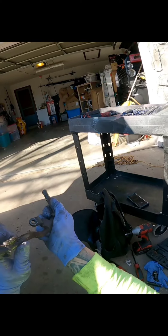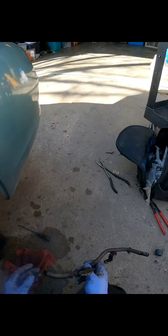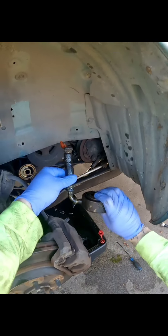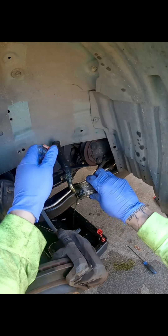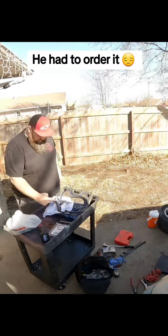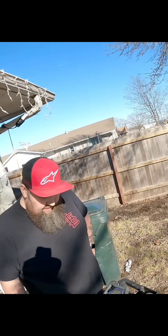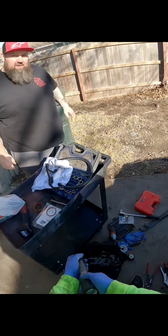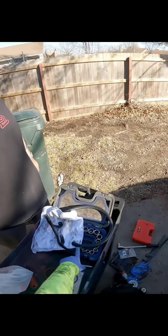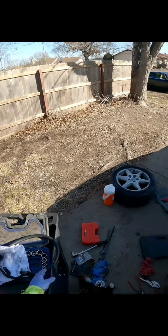I would for sure replace them. So yeah, look — oh boy, I don't think I'm going to be able to get one of those. They'll sell them though. He went down to get some hoses. So this is where that O-ring seal goes, and this hose is just a bit too big for it. I thought about just cutting that off right there, but the reason why that wouldn't work is because you'd have to flare it. I was just thinking about using it until the new one comes in — but I've tried hoses like that and it's never worked out.